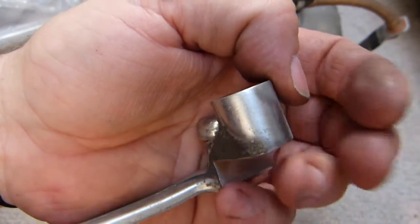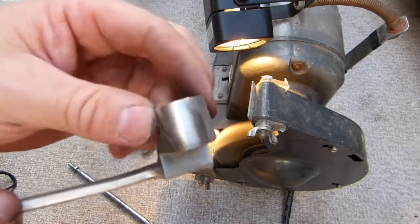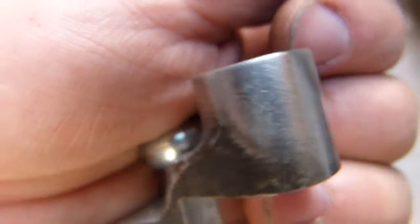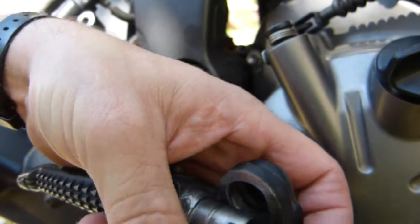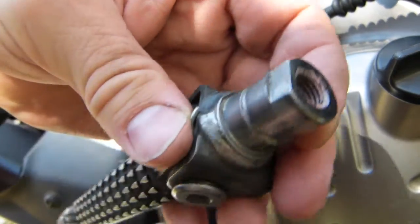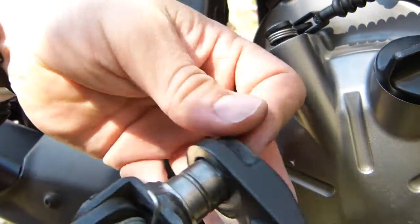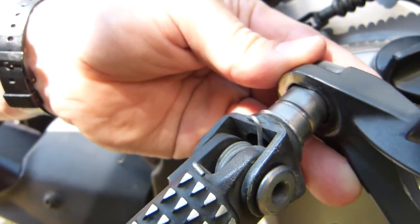It's coming along. You can see the surface that it polished — even aluminum. The brass wheel is a lot softer than aluminum so it's not going to gouge or damage it, just polish it. The corrosion is still somewhat visible but it won't look ugly. The foot peg mounting bolt also has red thread lock on it, so it should go back with fresh red thread lock. On the foot peg there is a flat surface that should meet with the flat surface in the bracket — that's how the bolt should go in, and those flat surfaces hold the foot peg from rotating.